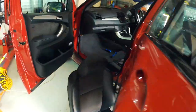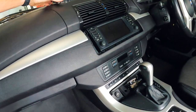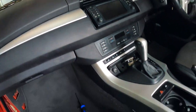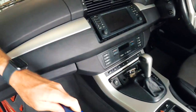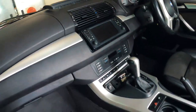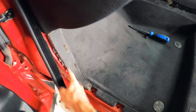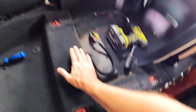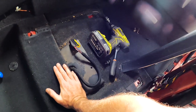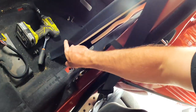We'll start at the front. If you're going to install one of these Android units in an E53, the first thing you need to do for the main screen is pop out this trim. I used a pry tool and there are some microscopic Torx screwdrivers in there — that's how the unit comes out. I've removed this side piece of trim so we can feed the wires down under the carpet. The door rubber has been removed, the trim here as well, and I've also removed the passenger seat — it just made it much easier to get this trim piece off so I can run the wire all the way around to the back.